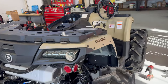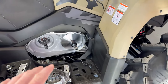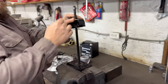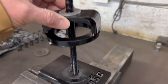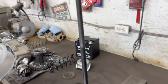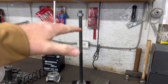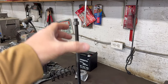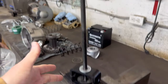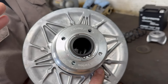Harman has taken the secondary off of the clutch as well as the primary, and we're putting on the Team MSC clutch kit. He's finished up the secondary over here. By the way, if you need a secondary clutch tool, we've got the exact setup you need at teammscparts.com — it's a Grade 8 bolt, you don't have to worry about it stripping out. It's got the exact length you need to completely decompress your secondary spring without having to shove and push — it fits pretty much everything.